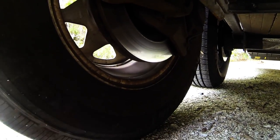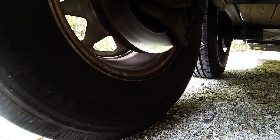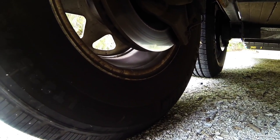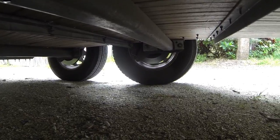We're checking our discs, making sure the four discs are not worn too thin. Looking at our brake line, making sure there's no oil, grease, or any leaks coming from it. There are no parts or puddles hanging underneath the wheels to indicate that anything's falling off or leaking, and no signs of hydraulic fluid dripping out.